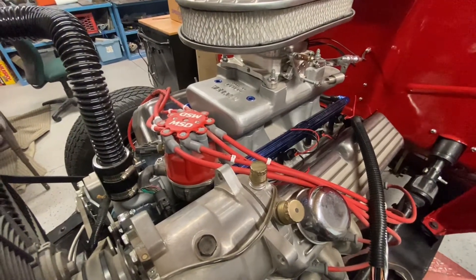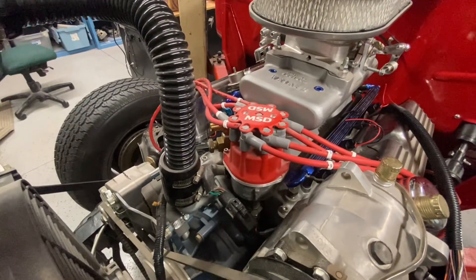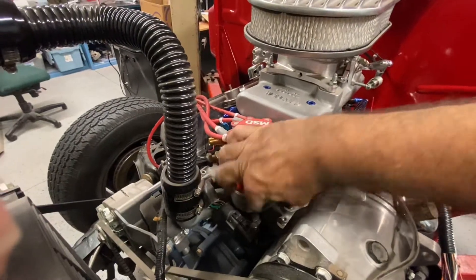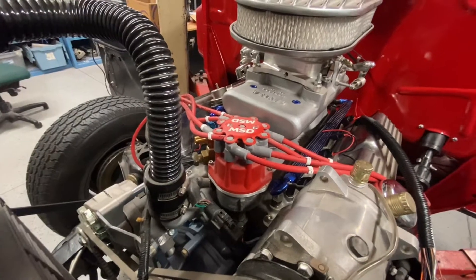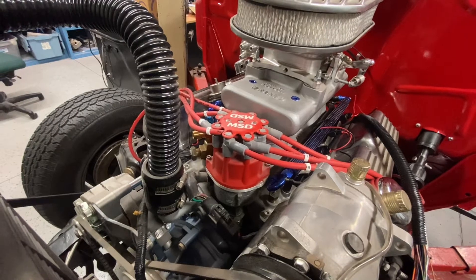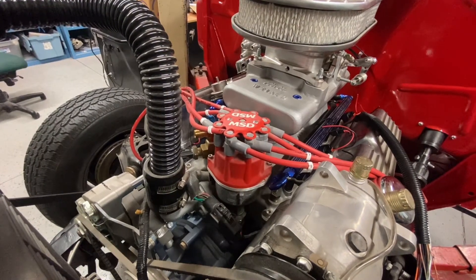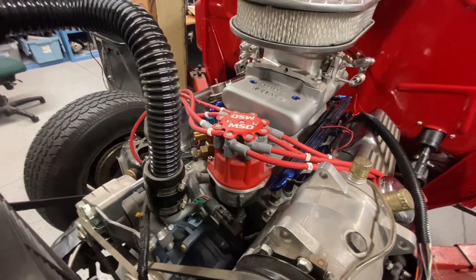Two of the items I have to figure out are for the ignition system. This is a Ford SN95 engine and distributor. The earlier Fox Body 5.0 Mustangs had a TFI module mounted right on the distributor, and I thought I'd do that just to make it easier to mount. But I found out in research that a lot of guys with the older Mustangs had problems with them overheating and stalling the motor out, so they would convert to the newer style with a remote-mounted TFI module on a heat sink. So I'm going to do that.